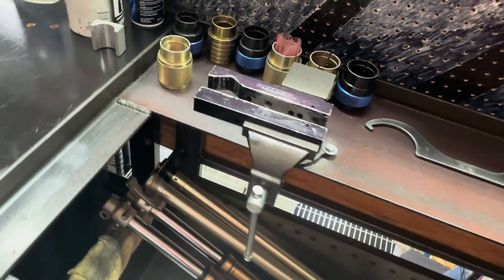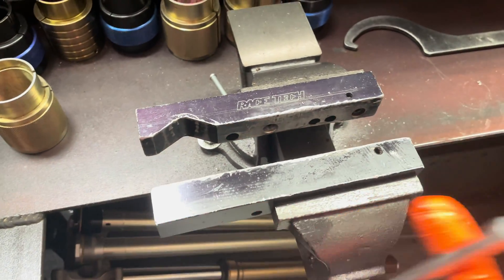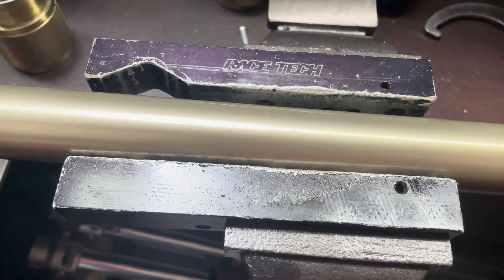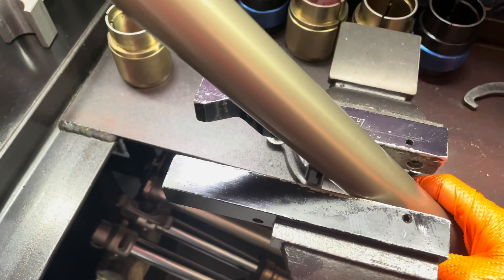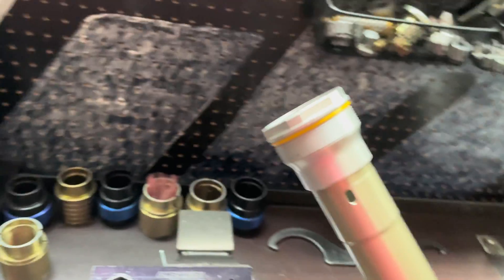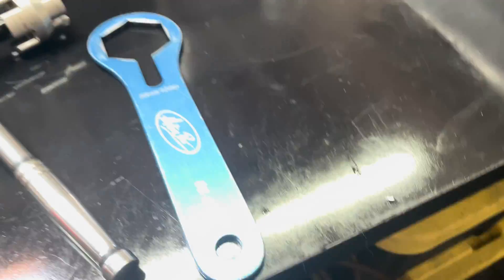If you don't have this setup and you have a vice with parallel jaws, be very, very low on your torque, because when you clamp a round object in parallel jaws you're going to be applying a lot of force on just two sides of it and it's going to easily go out of round. So if you do use this, clamp it very softly just so that way you can hold the fork cartridge, and then utilize your fork cap tool as the way of holding the cartridge from spinning as you remove the compression assembly.